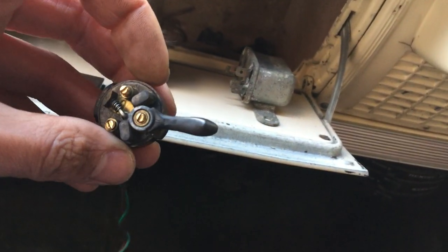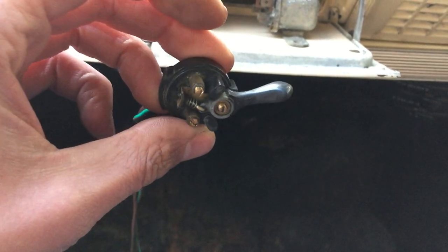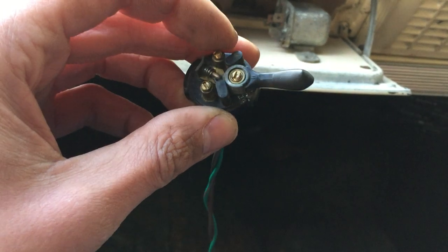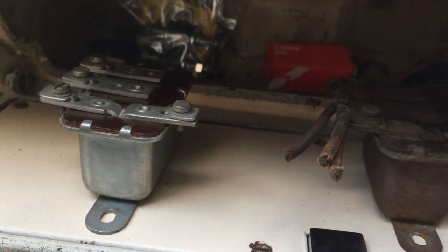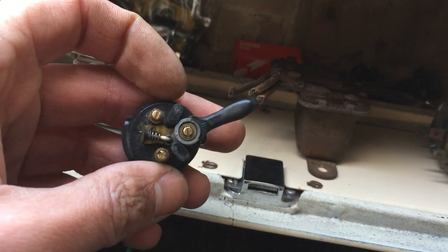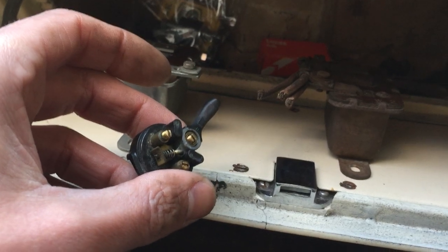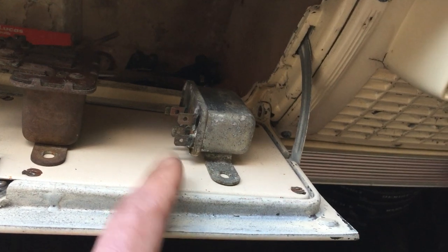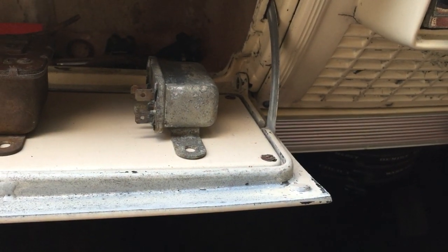I have been shopping for parts — panels — something to cover in a future video. This is the overdrive column switch, which I've removed. It actually surprised me because it's got three terminals. I do really enjoy working on stuff like this — it's proper old-school electronics with little grub screws. You can also see why they had to go over to Lucar terminals, because of the amount of time taken on the assembly line and the cost of the little components involved.